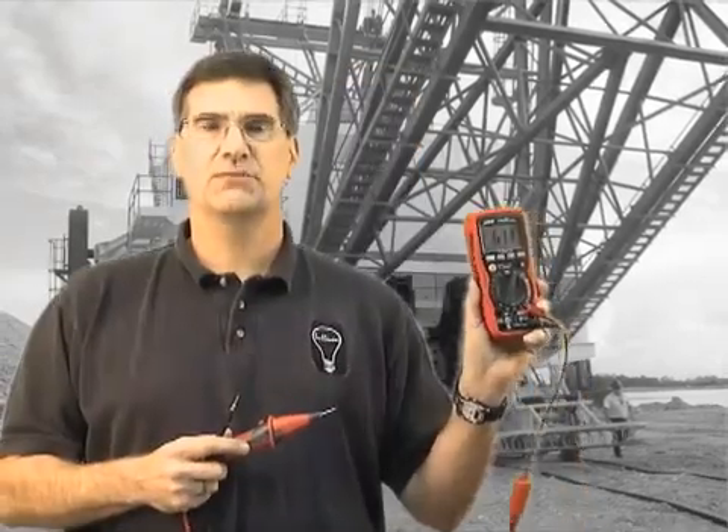If you see system voltage on your voltmeter when you're reading voltage according to manufacturer's instructions, then that means you can't have an open, you can't have a short-to-ground, and you can't have corrosion if you push this button and you don't see a drop. Voltage drop is immediate with this tool, and voltage drop is unquestionably the best way to diagnose a circuit.